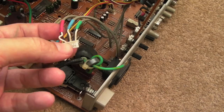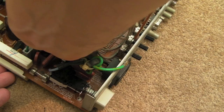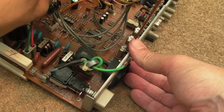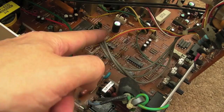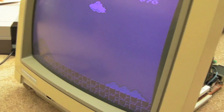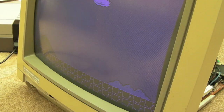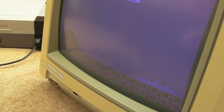What we're testing for here - we'll swap the inputs - so what was green before in terms of being driven from the board is now going to be blue and vice versa. So if we see blue as a predominant colour on the screen, that's a clue that it's the signals coming from here rather than something up here in the tube area. Well, that's the theory. Mission accomplished in terms of a diagnosis there - can you see it's like a purple sort of colour now? So I think we've got a combination of blue and red there, which shows it's actually a problem on the input rather than on the tube base. It's nothing to do with transistors and components driving the guns - it's something on the input.